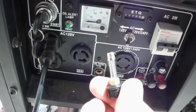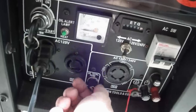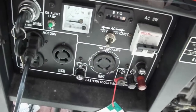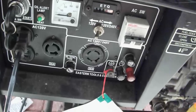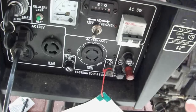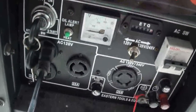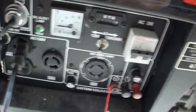It kept blowing this fuse — this is called the total DC fuse. I called up tech support and it does say in the manual: if you install the battery backwards, you'll damage the starter, flat out. So I disconnected the small red wire from the starter — not the big one — and noticed it wouldn't blow the fuse anymore. I took out the ignition switch, checked this panel for burnt wires, nothing was wrong. You can turn the switch on now and it doesn't blow the fuse.